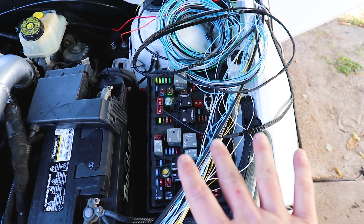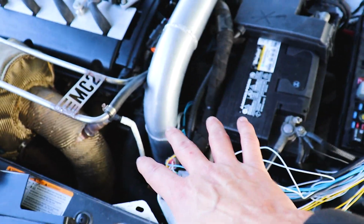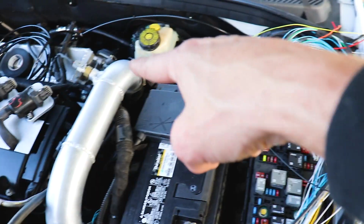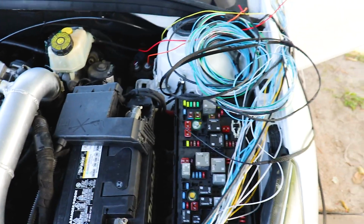We're getting fuel pressure, which I haven't touched just yet, just letting the car handle that for the second. The starter, need to figure that out. Then we can figure out whether or not the crank position sensor is set correctly, along with the cams. We can calibrate all that, but I may just have to go to the relay box here for the starter. Something tells me there's probably something going on with the ECU that I don't know. So let's do the hardwired path and wire the starter to have the FuelTech kick on the relay to get the starter going. It's a start.